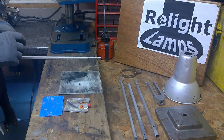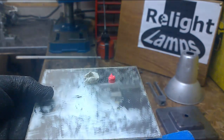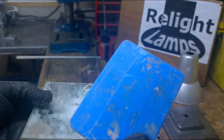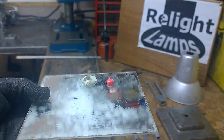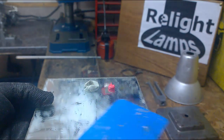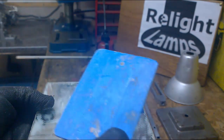your body filler. We have the hardener and the body filler itself. With a spatula, follow the instructions on your particular brand. Usually the percentage of mix is to represent the size of a golf ball to the size of a pea. In this case we don't need quite as much as that, so I just follow the general proportions. So thoroughly mix these two components together until the colour is uniform, and then apply it to the arm.